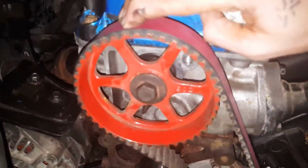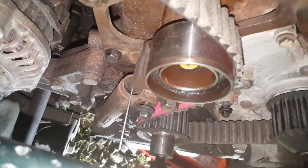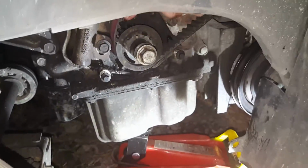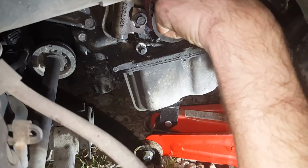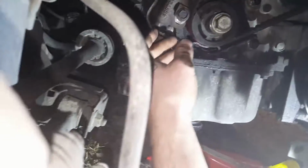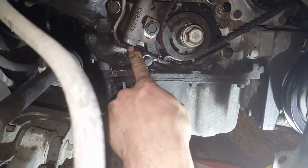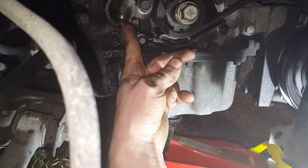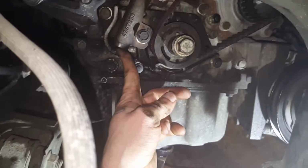Guys, so we got the belt looped around, top dead center up here, top dead center down there. Now we got the tensioner, the hydraulic pulley on there, which bolts onto these 2 bolts right here. And now, there's something in there. That'll be okay. But now we're going to take a pry bar, stick it in this little gap right here, and push this tensioner up as tight as we can get it. And then we'll remove the Allen key.